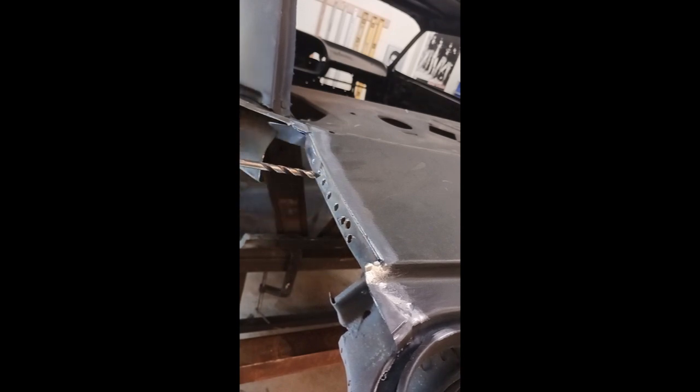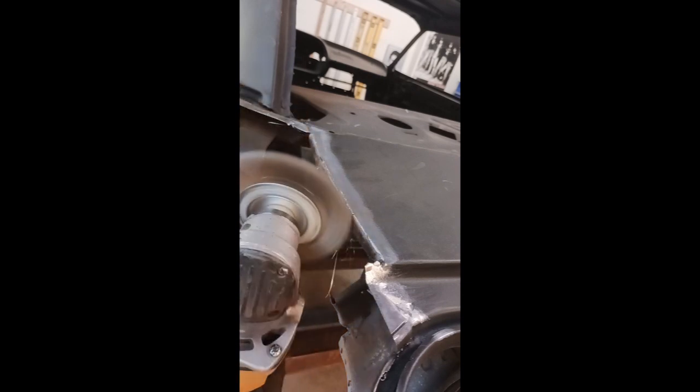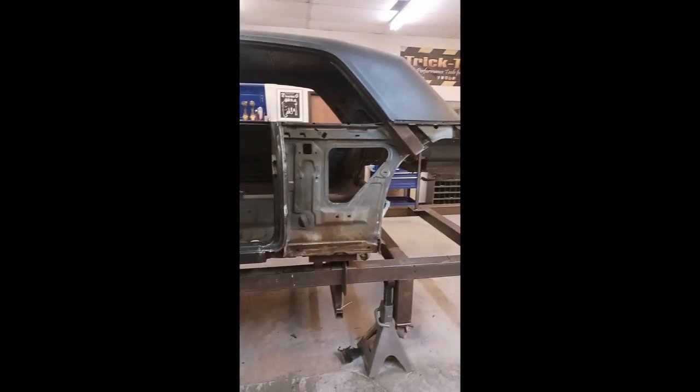On this flange I have to drill out the resistance welds, otherwise I'm really going to distort and cause damage to that panel, because there isn't a lot of lip there to begin with. So we're just going to get that cleaned up — hammer and dolly to straighten it — and now let's check our work. We've gotten all the flanges and edges cleaned up and straightened up. I know this is a wheelhouse installation video but it all goes together.